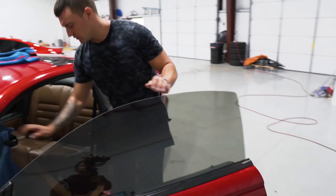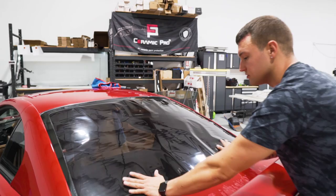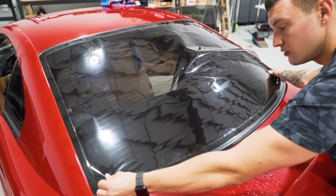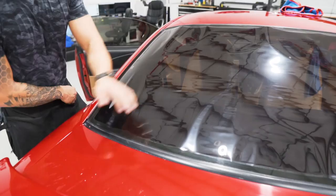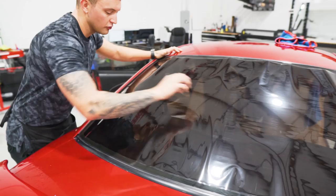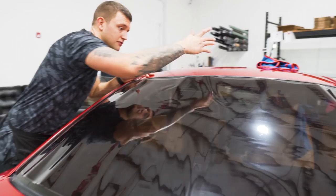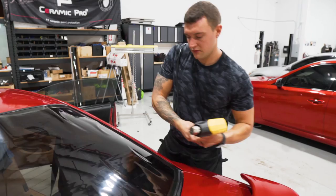Let's go ahead with the back window. I've got to throw the dryer sheet on there. Now we have the back window pre-cut. If you're hand cutting this, all you have to do is cut bulk material as shown in the installation videos and shrink it like we're going to do here. Lay down our H pattern. Now you can see with this back window, the fingers are fairly large, so the whole key here is to take your time shrinking and work small sections from you to the center, from you to the center. We're going to use the 3M felt card, double-check our H pattern, and use high heat, working in small sections.